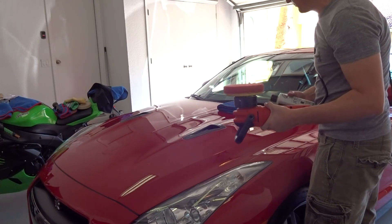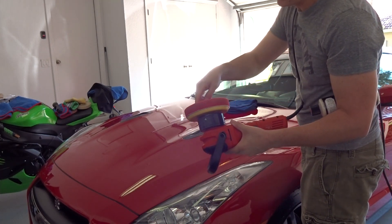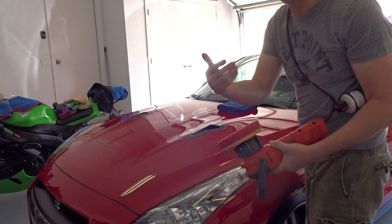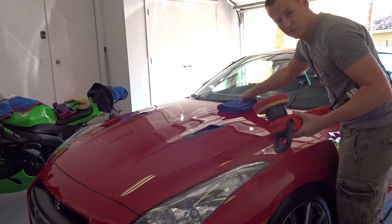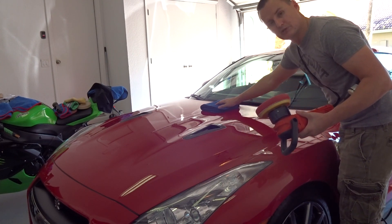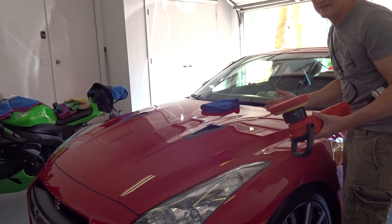I'm a little off camera right now but I'm trying to show you the hood, which is exactly what I'm working on. We're going to be using my Griot's Garage DA six-inch polisher with a red foam pad — it's really, really soft for applying sealants, waxes, or whatever. There's really no grit to it; it's just super soft compared to, say, an orange cutting pad or any higher-cut pad. You can apply this on your hood, windows, windshields, headlights, and you don't need a lot. Remember, thinner is easier — especially when it comes to applying waxes or sealants.